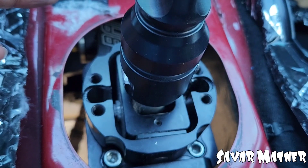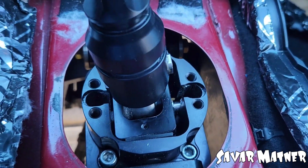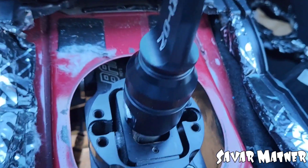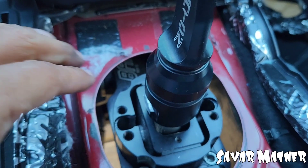There's a lot going on. I thought maybe he had the shifter on backwards — that's not what's going on. This is the push-down system. If I put it on the other side and try to go down, I won't be able to go into reverse. That's not the issue. What's going on with second gear is the way he has it trans-mounted and body-mounted — the linkage is off, and that puts unwanted strain on the gear selector forks.